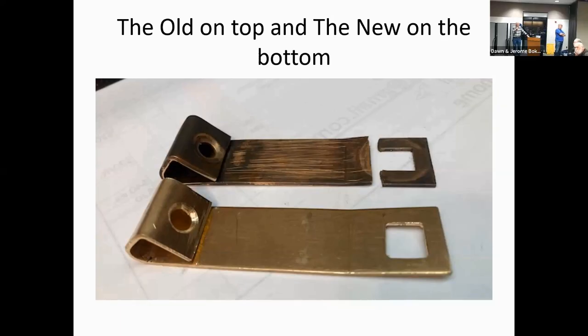You're talking beryllium? Yeah, I just worked on a big block. What's so different with the beryllium copper from regular copper? It's harder, so it doesn't wear out. Put regular copper in an injection mold, and the friction of the mold and the parts ejecting wear it out. The beryllium copper looks better.